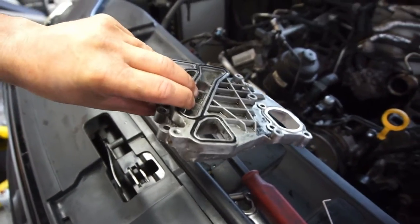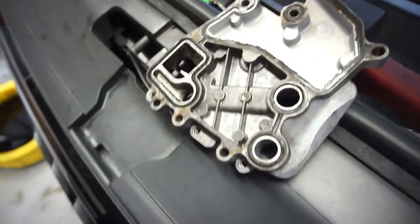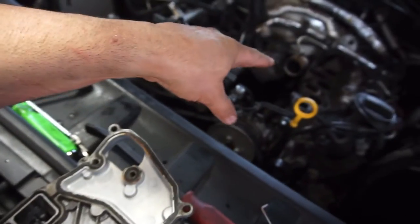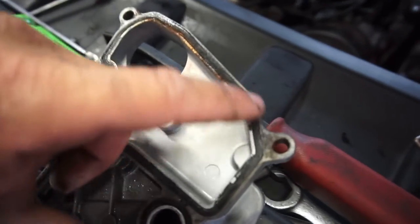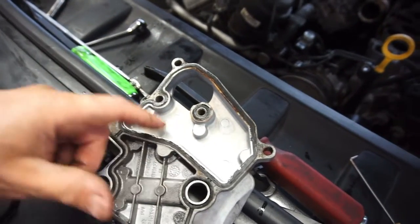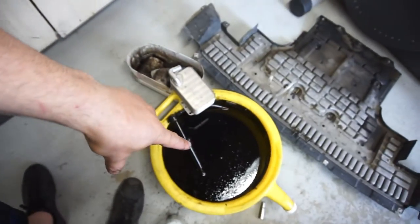I think this is probably the bigger culprit down here. You can see the oil cooler and oil passages because I have oil in there too. I think what happened was the coolant leaked through that valve, which in turn caused this seal to get eaten up. I'm assuming somebody put regular water in it, because it's an iron block - the rust comes in here, erodes this, and turns it to whatever. I have that seal and I should have the other seal too.